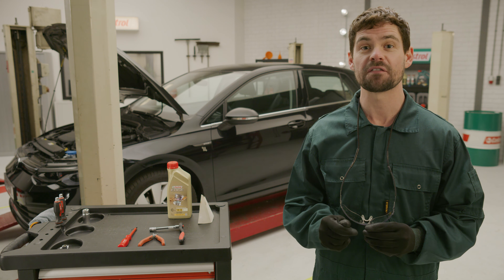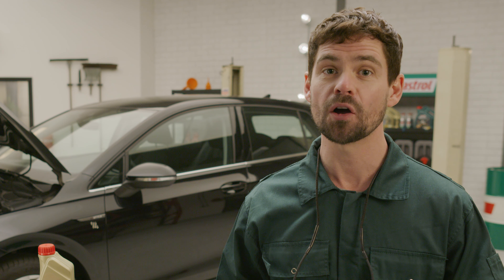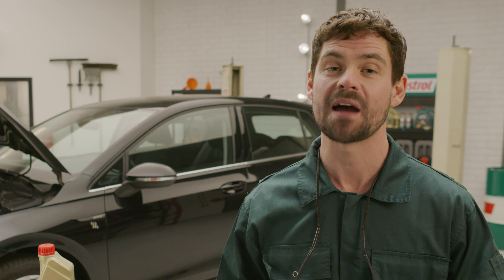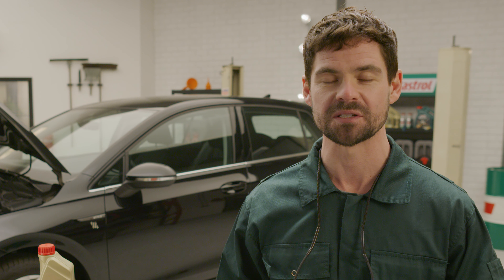Keep checking your oil level in between adding the small amounts. Start the engine to see if the engine oil light has gone off. If the light remains on, there might be another issue. If your oil level isn't measuring on the dipstick at all, it means your level is very low. It's possible that there's a leak, so check your vehicle and the ground underneath very carefully for spills.